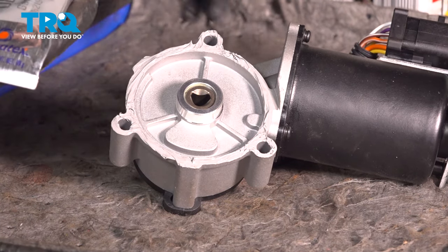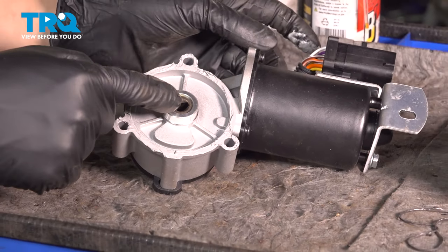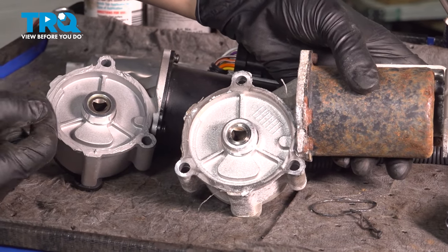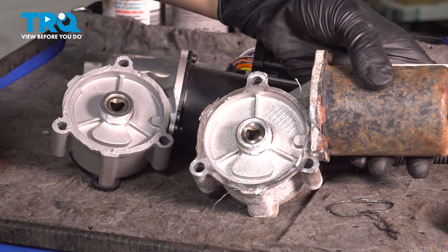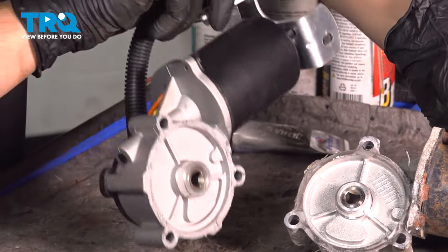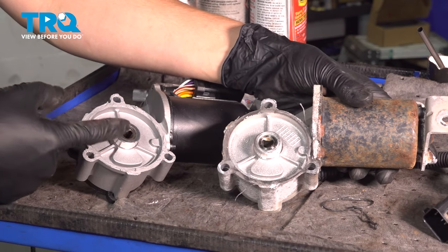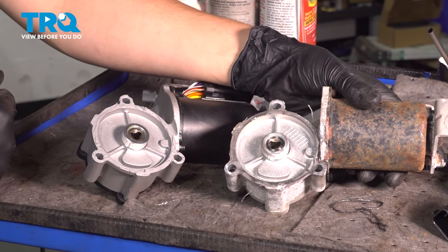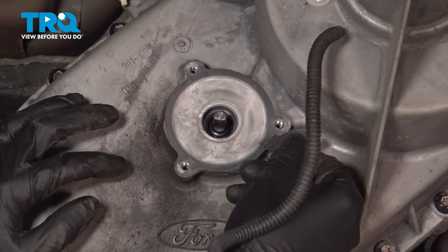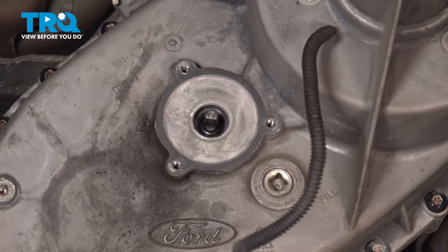A very thin layer all around will do the job. One thing you want to pay attention to is how the shaft is clocked. This one is very similar, if not spot on, so we're good to put it in. If it's turned in a completely different direction, plug the transfer case motor into the harness and activate the switch from inside — go to four-wheel drive and back to two-wheel drive. Most likely it'll self-position itself. If you have corrosion or remaining gasket material, just scrape it off with a razor blade and make sure it's nice and flat.